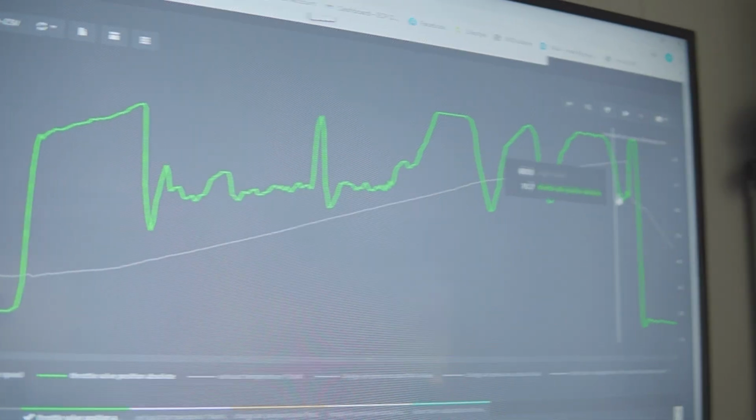So that's the OEM calibration again? That is a complete stock calibration. Yeah. As I said, that's one of the strategies the OEM calibrators use to help control the boost. Now, that by all means isn't great. One of the downfalls of a tuning box is you will have no control over that. So how that looks now, it'll be how it looks afterwards: the throttle open, close, open, close, open.